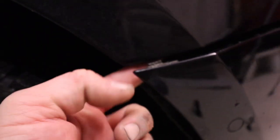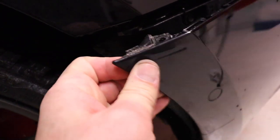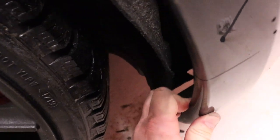It's a T20 which is locking the plastic with the fender here. When you're taking out the two 10mm bolts here, there are also two in the back but I don't think we're going to have to remove them. You just grab a hold and pull out — this is just plastic clips, nothing scary. You can see it's loose down there as well. When that's done, you can just take the bumper and pull it down. Now we can access where we're going to route it and where we're going to put the kick sensor. I also did the two 10mm bolts here — just take a screwdriver, take this lid off. Take it off and your bumper is good to go. Also put something under to support it.